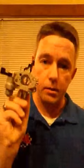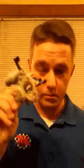Carburation, like I said, to me is the most important choice. And then you've got head work, your valve size and your port work, and all with modifieds. These little carburetors right here, this is just a bone stock, right out of the box 615 carb. Well, it's probably about 611, 612 right out the box. It has not been CNC machined yet, I don't think. I just picked it up off the table. But if it has been, then David Simpson, you in trouble, because this was laying in a place it wasn't supposed to be.